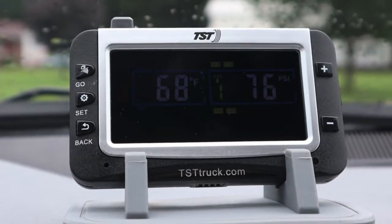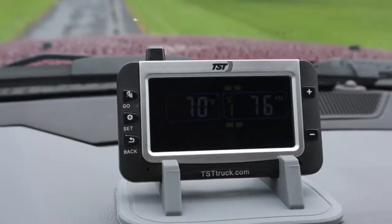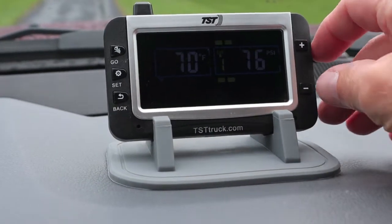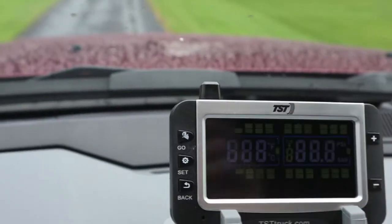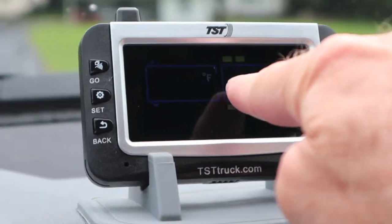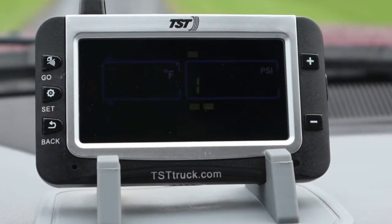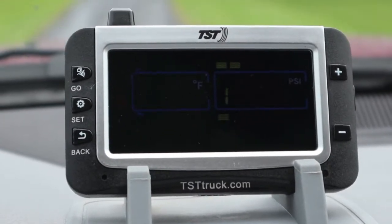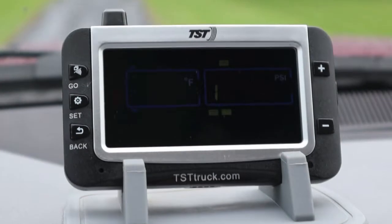The right rear was 73 and the left rear was 68 — we've got a five degree spread on that. Sitting at 100 yards, let's shut it off and see if it will reboot and acquire a signal. We're looking for the repeater icon — it'll come on right above number one. After five minutes, we cannot pick up the repeater. Looks like 100 yards is too far. Let's move up to 50 yards, turn it off, and see if we can engage the repeater.